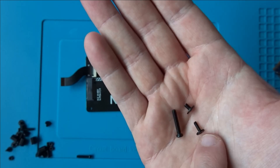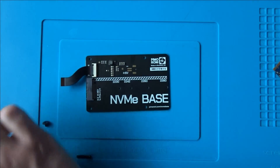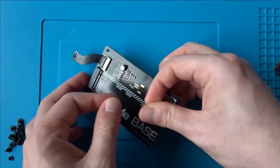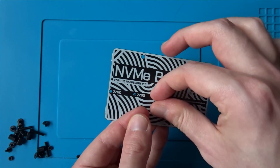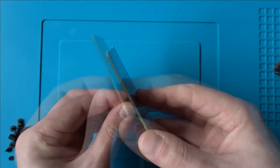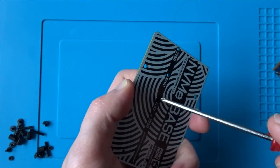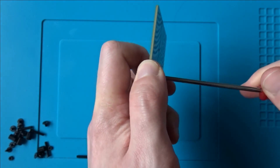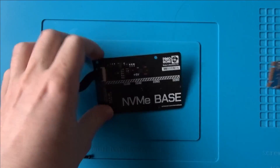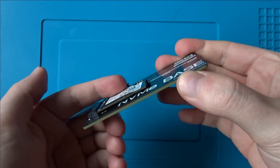There are three different lengths of screws that come with this kit. To mount the SSD, you'll want to use the medium length screw — the middle one of the three. Slot this through the relevant hole on the underside of the NVMe base, then use a nut to hold the screw in place. The SSD can then be installed with another nut used to secure it against the screw.